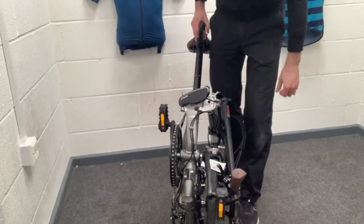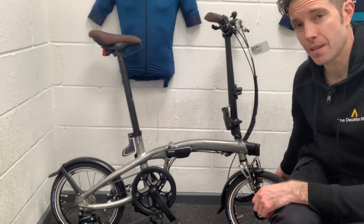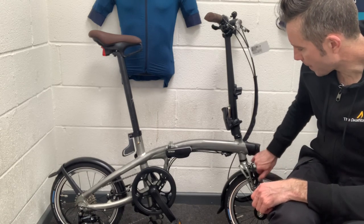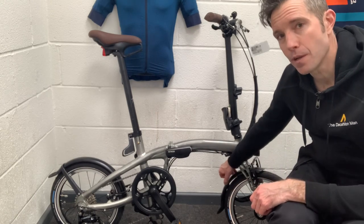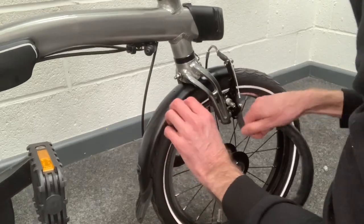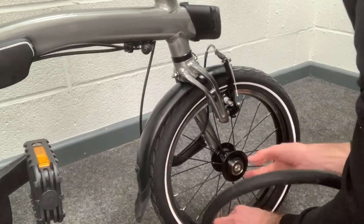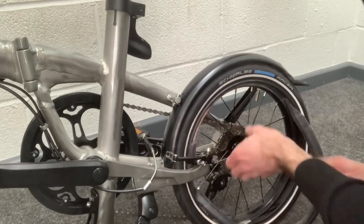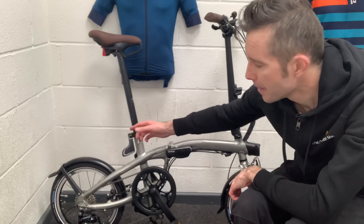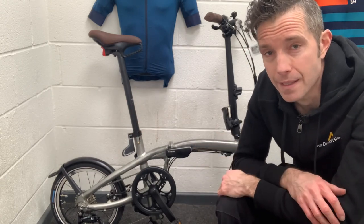The reason for that is because they actually have a one-sided fork. This side is where the fork is attached — very strong — and on this side the mudguard is attached. On the open side, you have absolutely nothing in the way to remove that tube nice and easily. The same goes for the rear — it's the chainstay that's missing on the opposite side, which again allows you to remove the tube easily if you get a puncture.